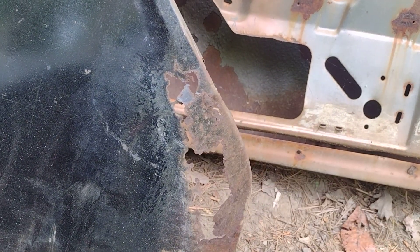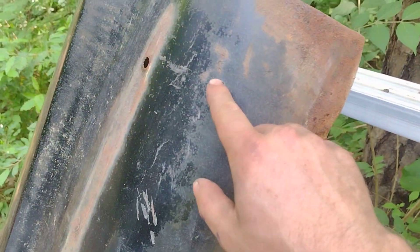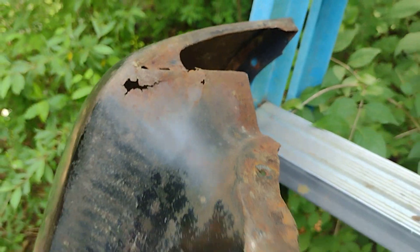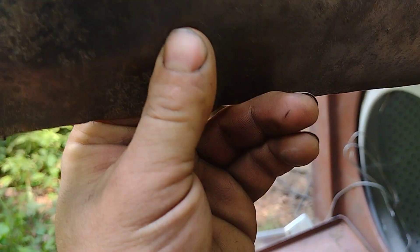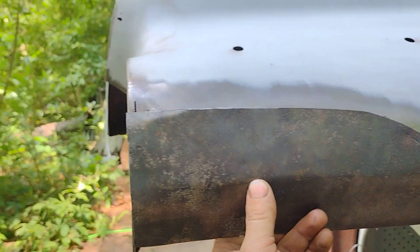I don't want to pull out too much because it's got a little bit of a curve. I had to remake this bottom a little bit right here. This other side is fine — it's got surface rust on it but I think it'll clean up. We've got one pin hole and a little bit of rust right there, but this side is fine. I really want to make a template off this. It looks a lot better now — it's straight all the way down. I might have to pull the lip out just a little bit more, but we've got the curve straightened out — that's the main thing.